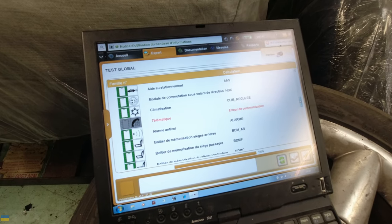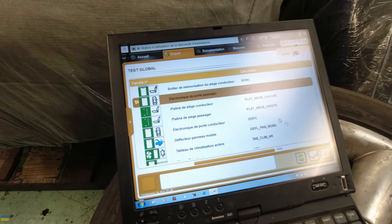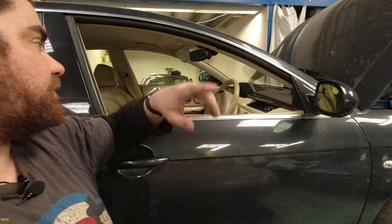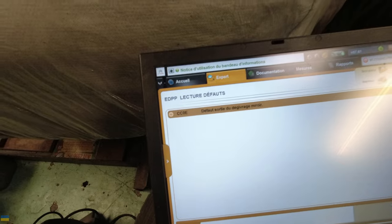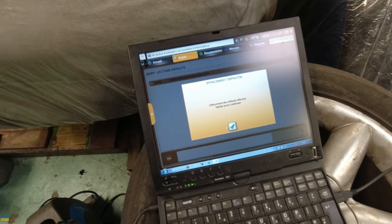It's got ECUs here for the spoiler, parking sensors, alarm, passenger door — there's a fault code logged on the passenger door which is still there. I know what that is: it's the auto-dipping rear mirror. When you put the car in reverse the mirrors tilt downwards so you can see the curb, which is quite clever. Only that one doesn't — it kind of does that and then does that and gets all confused. So I'm going to try and reset it and hopefully it will just stay away — I'd rather have no dipping and no fault codes.